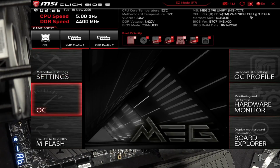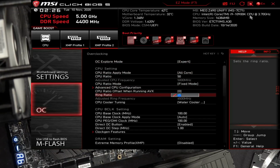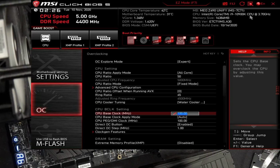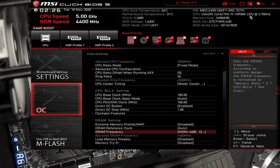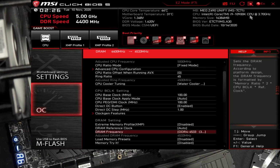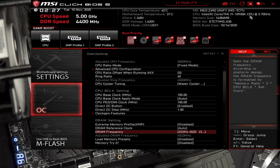Right, the only time you see a performance benefit from having more memory is if you run out of RAM and the operating system has to start stuffing things into the page file, because the page file is on your SSD or your hard drive, and it's really, really slow compared to your main memory. So that's when RAM capacity actually starts mattering, but otherwise it doesn't do anything for performance.